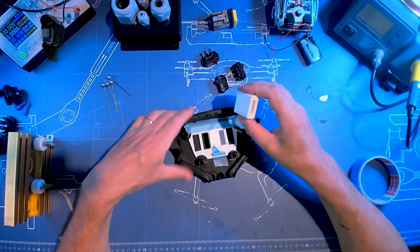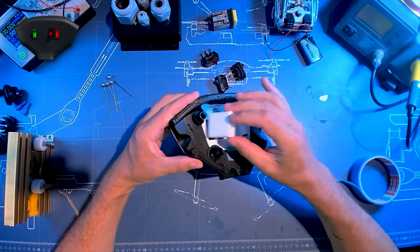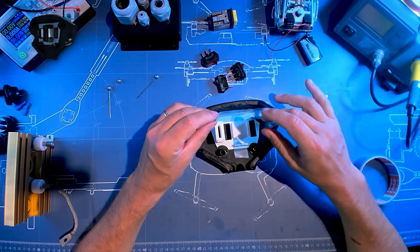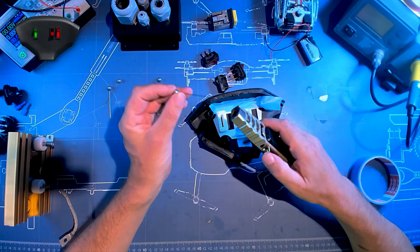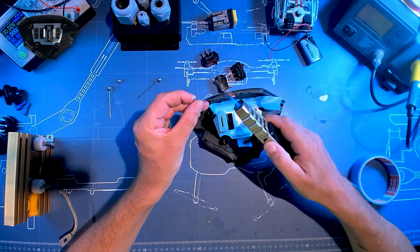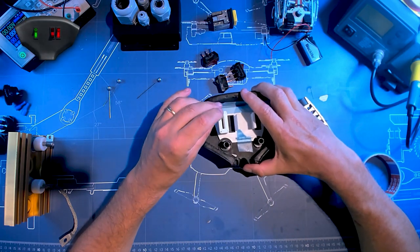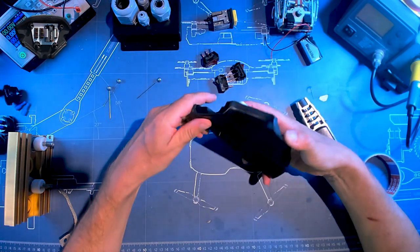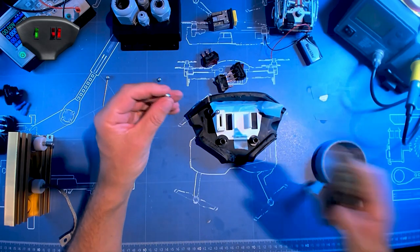To make sure we cut in the right spots, we have designed this little placeholder that allows us to pierce the center pad with a needle at the right angle. As the inner plastic is pretty strong, we have to heat our needles first. Once the needle is glowing, it'll pierce through the plastic easily. We now do this for all four corners.